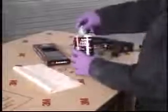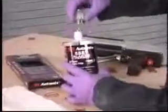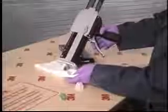Spray the front side repair area with 3M Automix Polyolefin Adhesion Promoter, part number 05907. Be sure to use 05907 for this step. Allow to dry for five minutes. Prepare a cartridge of 3M Automix Easy Sand Flexible Parts Repair Material, part number 05887. Be sure to equalize the cartridge before attaching the mix nozzle.